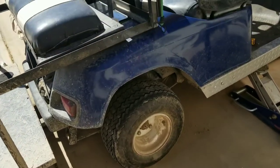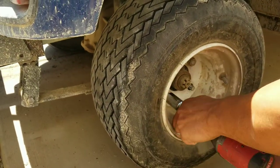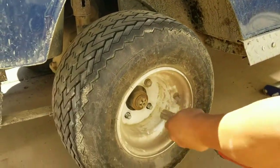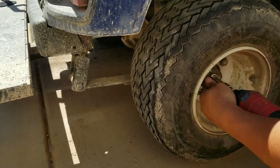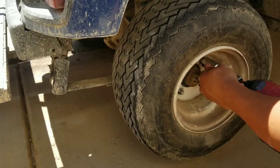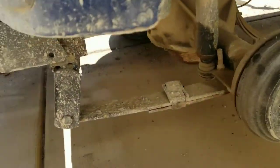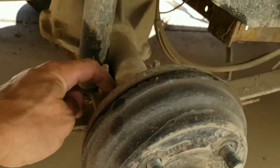We're back now, going to do this side. The other side's good. First thing we're going to do is lift and unbolt the bolts for the tire. We got this side pried up for extra stability. Remember: when one leaf breaks, do them both — don't be cheap, just do them both. The tire comes off here. We got our axle here. Everything that holds this on is the rear shackle, front shackle, and these U-bolts.